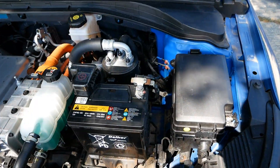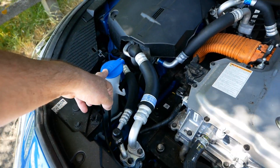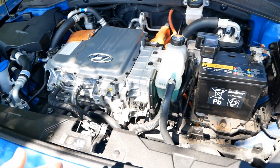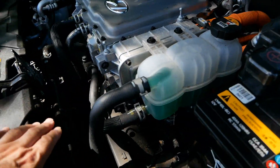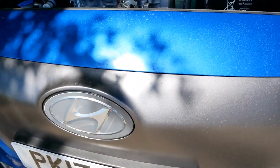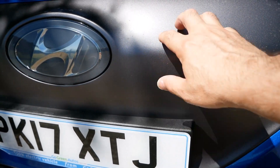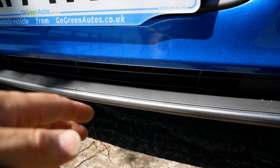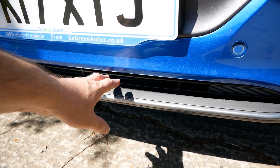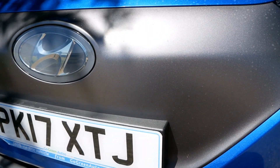The rest is standard car stuff — fuses, brake reservoir, windscreen washer bottle, air conditioning top-up lines. Because it has a cooling system, you still have a radiator, and there's a big fan on the back of it just like every normal car. However, there's no grille at the front — it's blanked off here. On a petrol or hybrid version this would be a vented grille. You still have a very slim air intake down here going through the radiator; you just don't need as much cooling on an EV as you do on a petrol engine, which is why they blank this off.